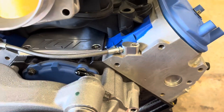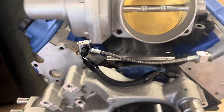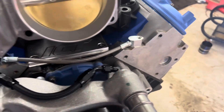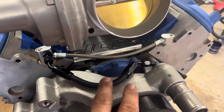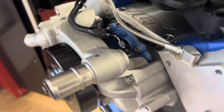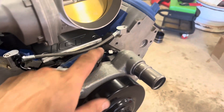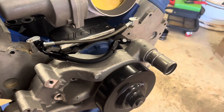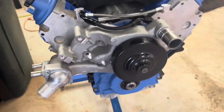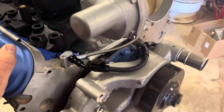I didn't have a 90 but I did have two 45s, which works — this hose may need just a little shortening, it's just mocked in right now. The water pump only has a couple bolts in it; I won't fully install it until it's in the engine bay. That's what it's going to end up looking like. If you're going to run your steam line, this is one of the cleanest ways to do it. It all goes back to the radiator — simple and clean. This throttle body doesn't have any provisions for a steam line, so this is what we're going to do. If you like the video, like, comment, subscribe — catch you on the next one.